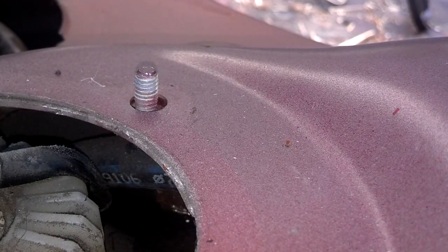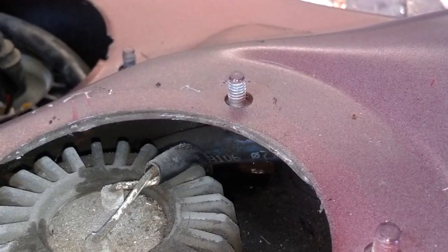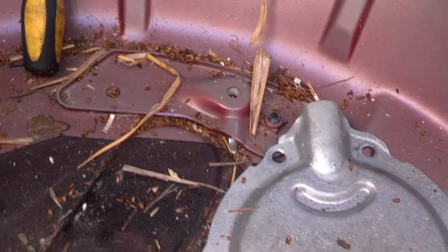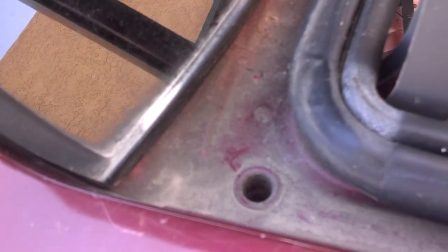If I'm not mistaken, somebody on Matthew's site drilled a hole in the floor and replaced this hose, so I'm going to check that thread and see what it'll take to get that piece replaced. Next, I'm going to vacuum out the bottom of this trunk — it looked like something was living and nesting back here. I did chase a spider out, but something was laying a lot of eggs back here at one time. I also cleaned out the drains that go down through the trunk. These allow water, snow, and ice to drain off — they're connected to tubes that drain under the car — but they were plugged up with debris, so I vacuumed them out.